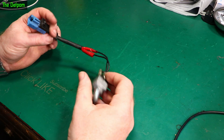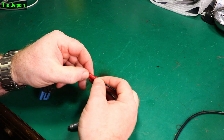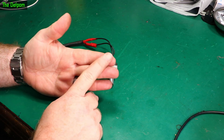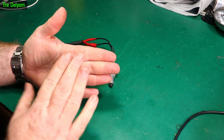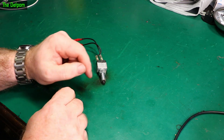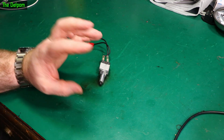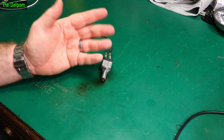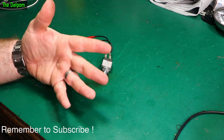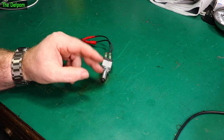Here is the switch out. You can see this has been replaced before — this is not the original, it's got a join in here. What I also noticed is that when I took this out, on the actual pedal there's supposed to be a little disc on the front which pushes against this switch activator. I actually found that on the floor broken on the bus. I was already really suspicious about what this thing was — it's basically a little plastic disc, but it's gone waxy and lost all its strength. The plastic's broken down, fallen apart and fallen off.